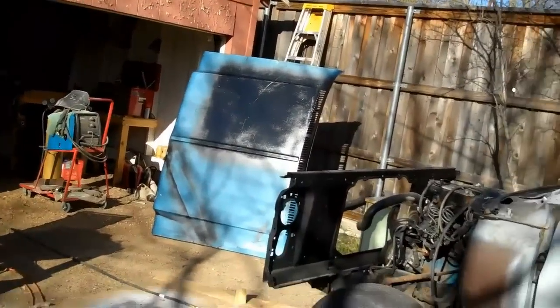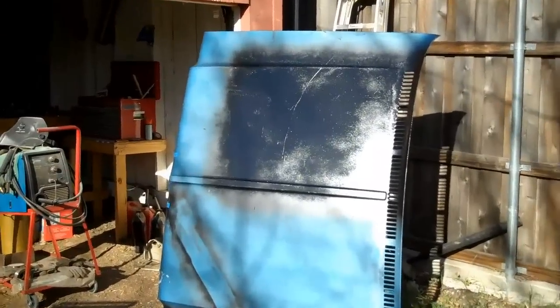Something you need to take into consideration if you're going to use the product during your prep time — go over the whole thing with real fine sandpaper, 300 or finer. Otherwise, your scratches will show through this Dupli-Color primer. It's real thin. So I'll come back when that paint on the hood gets all dry, wet sand it, and just keep filming. Like I said, this is an experiment and we'll see if this works.